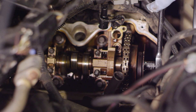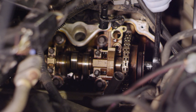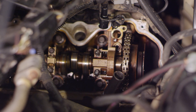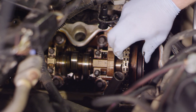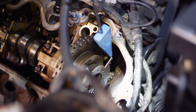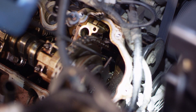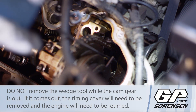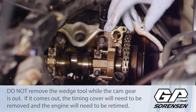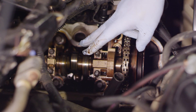I'm taking a pick tool and making a scribe mark so I have a good mark on my chain before I do anything else. Now I'm going to take a ratchet with a 15 millimeter socket, grab the bolt on the front of the cam, and simply break it loose. I don't want to remove this yet - just break that bolt loose so it'll be much easier to remove the phaser assembly later. Now we're going to take our wedge tool and slide it down in between the timing chains by the tensioner to hold the tensioner from collapsing and keep the chain in place.